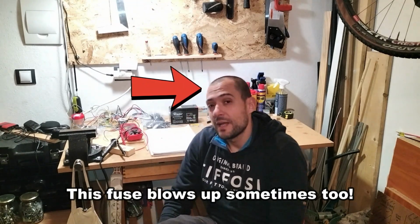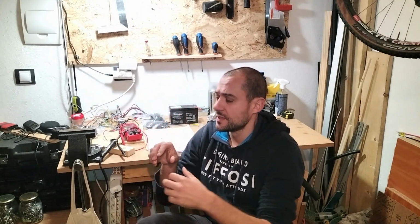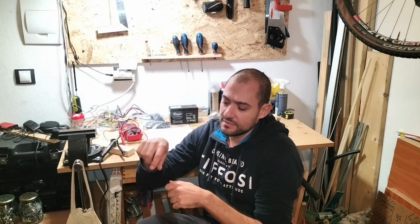No problem. Second time, again when I was wiring everything in the dashboard, I had to disconnect the dashboard, and then when I was testing everything, I ended up turning the bike on without the screen, and that also made the engine check light turn on. So when I put it back together, the engine check light was there. I didn't do anything. I didn't go to Honda this time. I rode the bike for a couple of hours, turning the engine on and off a few times. And because the problem isn't there anymore, the engine check light just turns off.